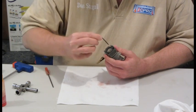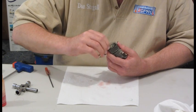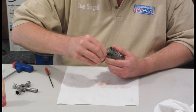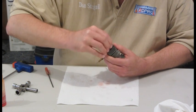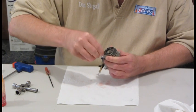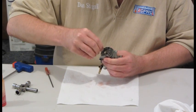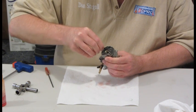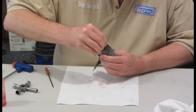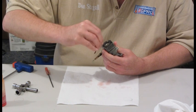Once you develop the feel it's okay to use the long end so you can use all your fingers — don't strip the head; if you strip the case you've ruined the engine. On the four-bolt engine there's not much of a pattern, you go across. With a six-bolt engine you use a different pattern for tightening the bolts.